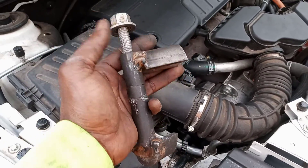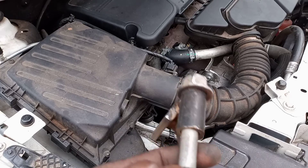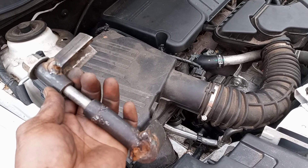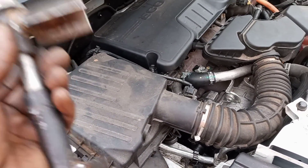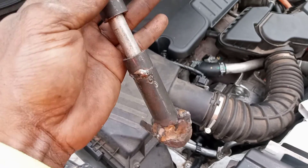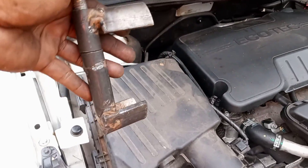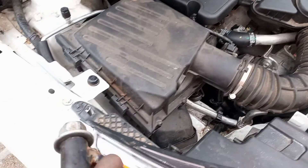That's how you do that. Welders can make their own tools — this is actually a tool that I made to fix this. If you ever have a problem and need to compress a spring on your 2010 to 2014 Buick LaCrosse — this is a 2013 — this is something I made with a heavy-duty anchor bolt that you put into concrete, and then I used some more metal and made a few things to brace it down. That's why I got an offset on it, so I can clamp it down, screw it, and easily remove the cover. Everything worked out good.